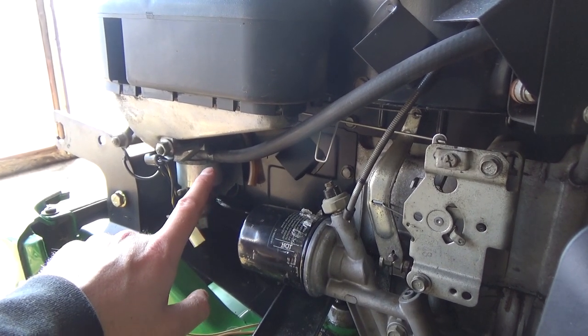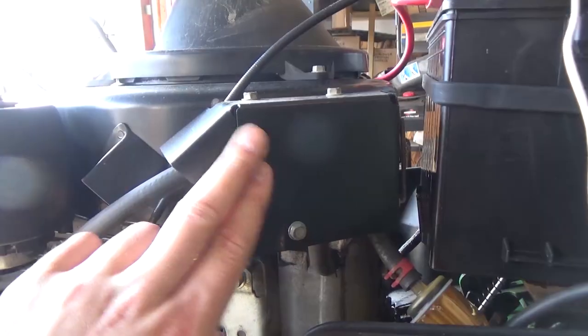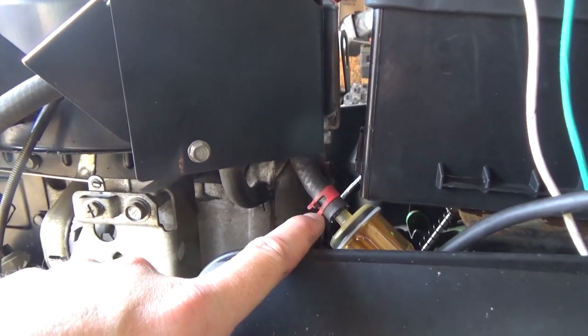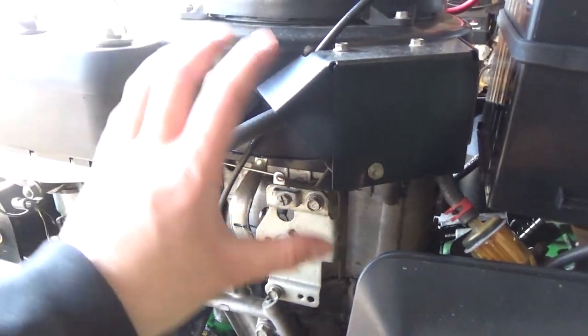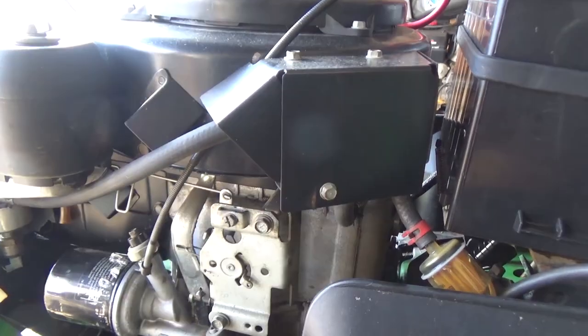Because this engine runs, I've gone ahead and reconnected the fuel line up at the carburetor. This engine has a fuel pump bolted to the engine, and I don't want to remove stuff if I don't have to. So I'm going to come over here and remove the fuel line right at the fuel filter — we're going to be changing that anyway. That way when I disconnect the engine I can just pull it up without having to worry about disconnecting the fuel pump.